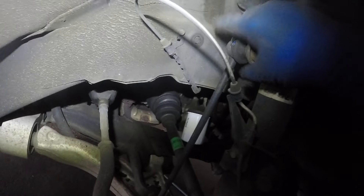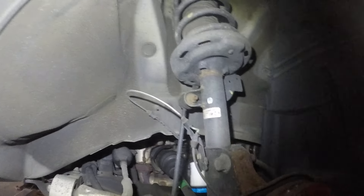Even though we don't see any play in this bushing, it can still be bad. Right now we've got a lot of load on it — I feel some force in this one. Look at the linkage here, the boot is completely shot. When you have load on it you're not going to feel much, but the key point is: change your links, bushings, and shock — three things together.